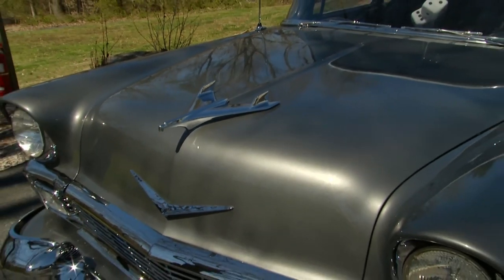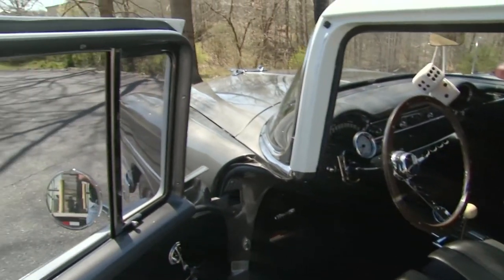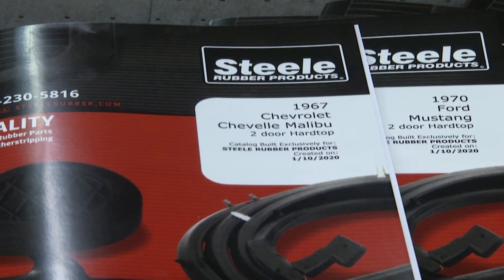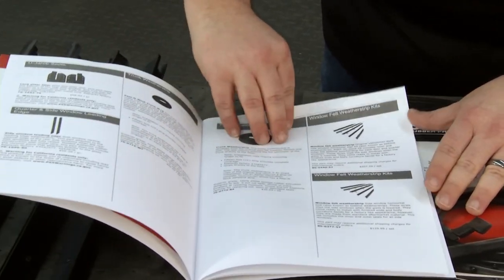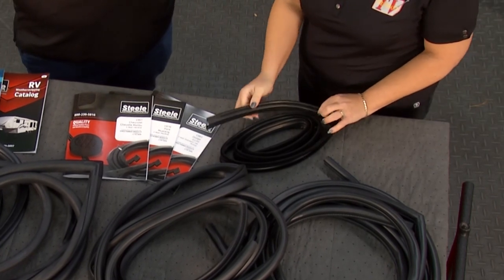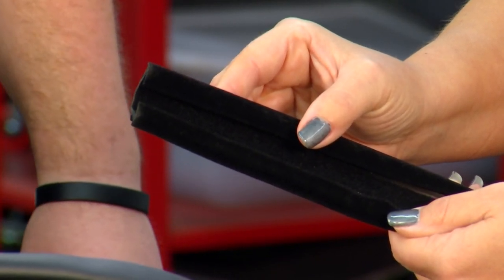So if you're doing a complete ground-up restoration and you think you know what you need — quarter panels and all that stuff — but when it comes to all of the different weather stripping and rubber type pieces, you're not going to know everything you need, but you guys can help with that. We make year, make, model, and even style-specific catalogs, and they're so helpful because everything in there is for your vehicle. It shows all the options right next to each other. So if we have more than one type of windshield gasket, it shows them right there, shows what the difference is. We even make stuff that's not necessarily what came on the car — like a run channel for a vent window delete system. If you're wanting to take out the vent window and put in a full-size glass, that run channel will replace where that vent window was.